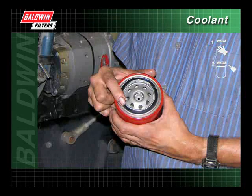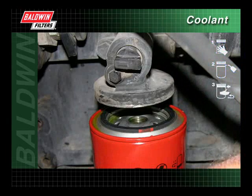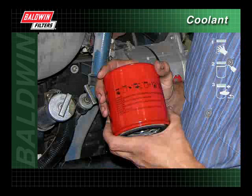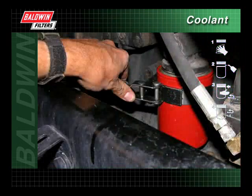Apply a thin film of clean motor oil to the filter gasket — do not use grease. Line up the threads on the filter with the threads on the mounting base carefully to avoid cross-threading. Screw on the new filter until the gasket comes into contact with the base, then follow the instructions of the filter manufacturer for final tightening. The pictogram on the filter will tell how many additional turns from gasket contact the filter requires. A filter strap wrench may be needed to ensure proper torque; place the wrench near the base plate of the filter to avoid damaging the filter during installation.